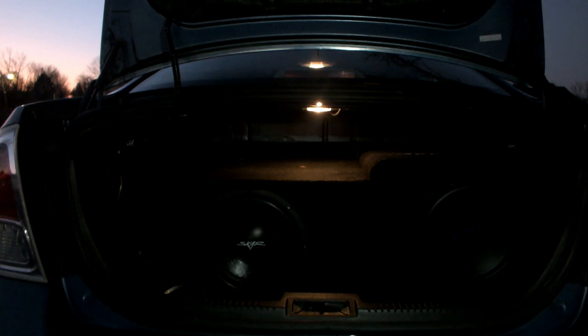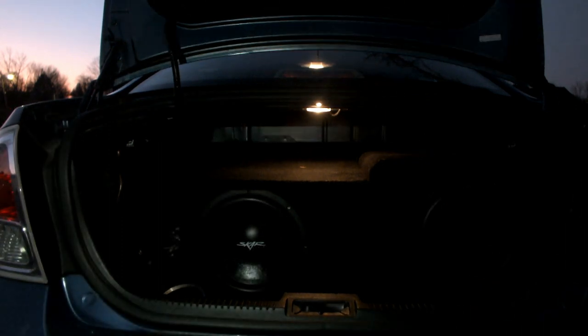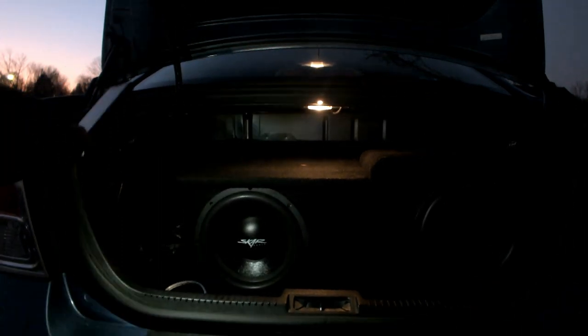Now the amp's on. Nothing. So guys, I'm going to take the camera off just so I can show you inside the vehicle here. That's the connection back there — that little box right there. That's the ground loop isolator. And that's all it is, guys. So if you're having any kind of noise or any kind of problem like that in your car — we troubleshooted a couple things and this is exactly what we came across and it solved the problem.